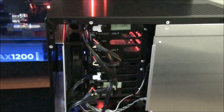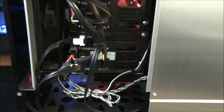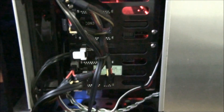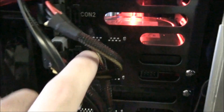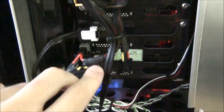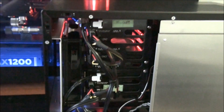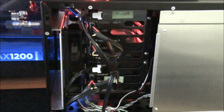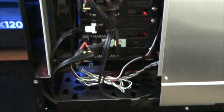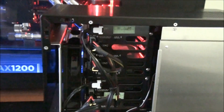This is unfinished because I haven't installed all the drives that I intend on installing. I also ran out of SATA 3 data cables because all the ones I have are 90 degree on one end. As you can see, you can't install 90 degree SATA data cables on two of these ports, or that one either — it needs to be straight on both ends for those particular connections, and there are three of those. So I didn't have any completely straight SATA data cables; I'll have to order some so I can complete the build. I also need to get more hard drives.